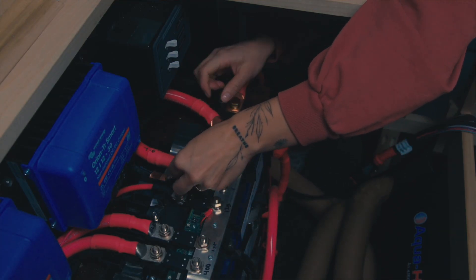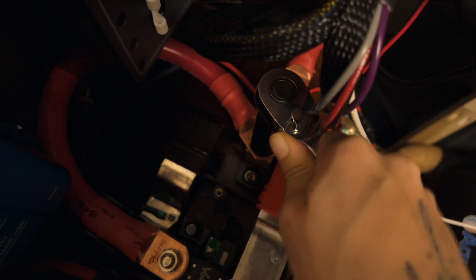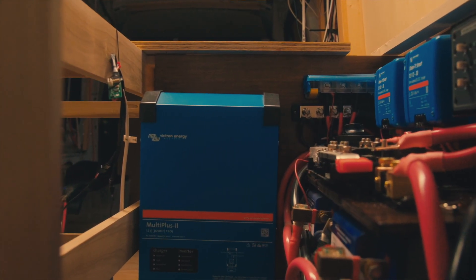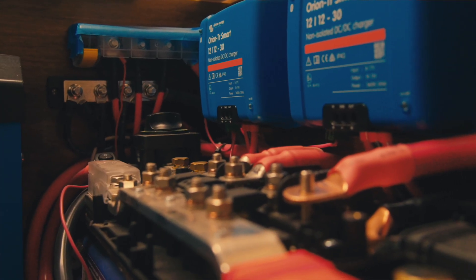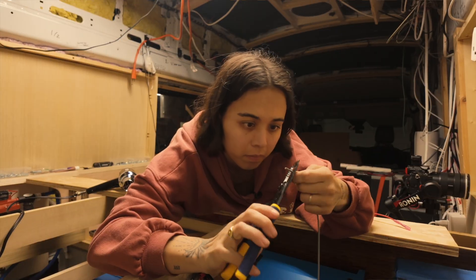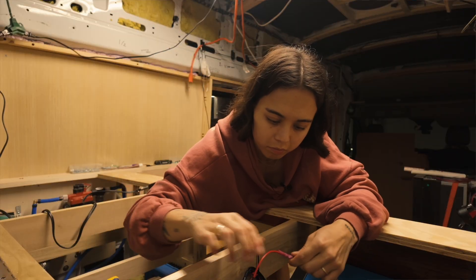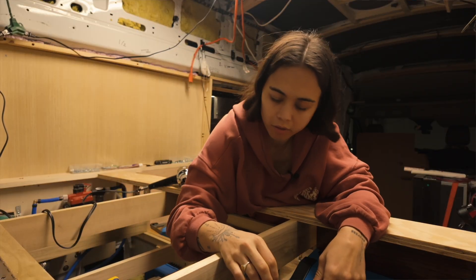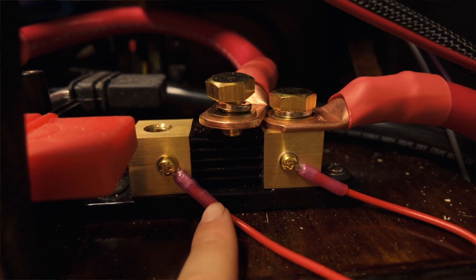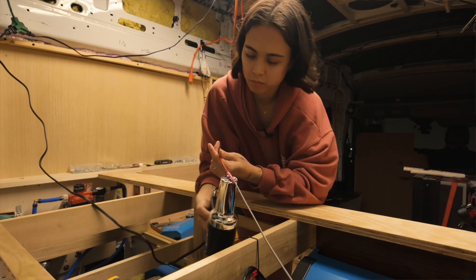The four-aught negative wire connects to the empty spot in my Lynx Distributor, then I made a cable connecting the empty side of the smart shunt to the Lynx Distributor and added the 300-amp mega fuse. I already had a relay connected to the engine run signal which connects to ground when the engine is running. The Wake Speed needs to see 12 volts when the engine is running, so I used a set of normally open contacts on a 12-volt relay to pull the brown Wake Speed wire to 12 volts. On the Wake Speed: the black wire goes to the negative distribution bus bar; the red wire is the regulator positive power and connects through a 15-amp inline fuse to the alternator side of the 300-amp fuse; the purple wire goes through a 5-amp inline fuse to the alternator side of the shunt; and the gray wire goes through a 5-amp inline fuse to the Lynx fuse side of the shunt. In my application I didn't use the white feature-in wire.